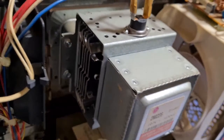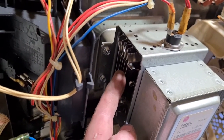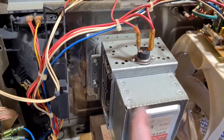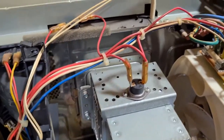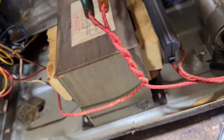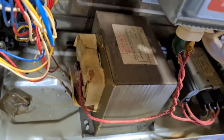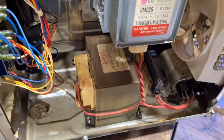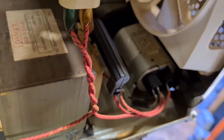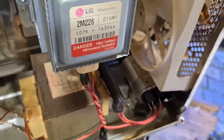This is the magnetron. So as you can see, these fins here are usually aluminium, so we can take them off. There's a little bit of copper inside the magnetron itself. There's a little switch on top that will contain a little bit of silver, and the real thing we're looking for is the big transformer. So as you can see, the transformer is a fair size, and in here and in here is where the copper is. So let's get all these components out and give you a little bit of a look at them as well. See over this side there's a capacitor. Capacitor is aluminium but full of liquid and not something I mess around with. Okay, so let's get these components out.